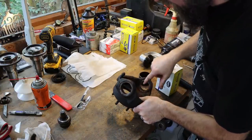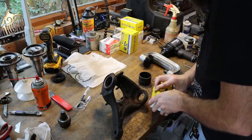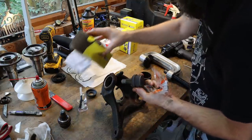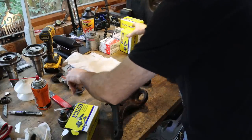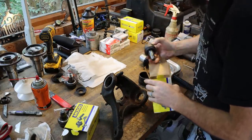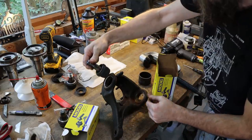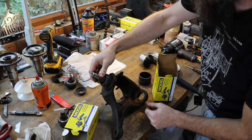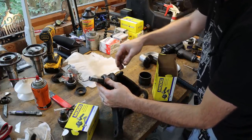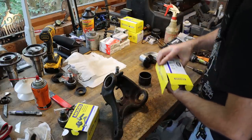So we've got our seats all cleaned up, and we want to make sure that these seat good and solid. We'll put the top in first. That is the bottom. And there is the top with the grease fitting. We'll point that grease fitting towards the back of the truck, not completely towards the back, but really according to the instructions, that's the only way you can access it and not have it obstructed by parts on the truck.